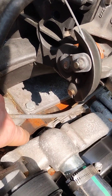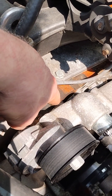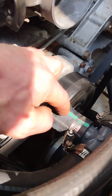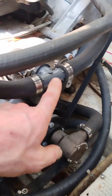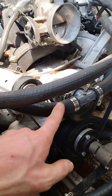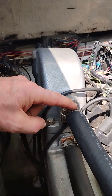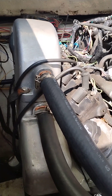Water goes through the block. Water exits the block through the top port, out of the block, through the water pump, out of the water pump, into this T. Comes out of the T and into the top of the exhaust riser. And then from there, exits out the block of the engine.